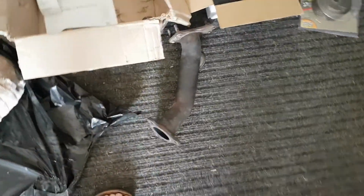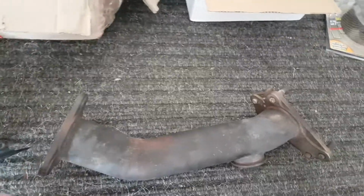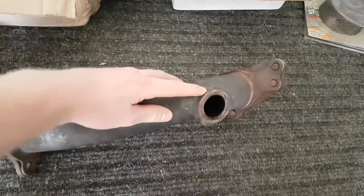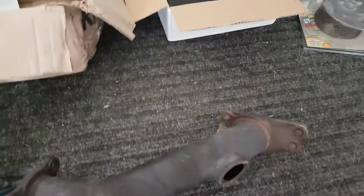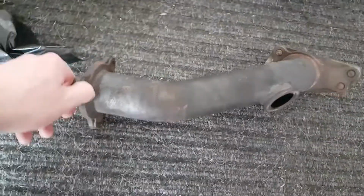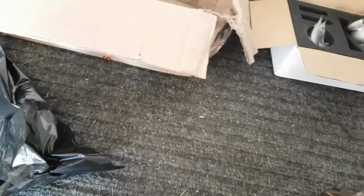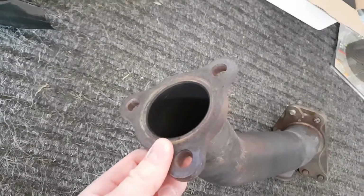and then at the same time, I purchased just a GT spec uppipe. The reason I went with this uppipe is because the Tomei uppipe that comes with these headers doesn't have the external wastegate flange, and I'm running the external wastegate setup with the Tial wastegate over there, the 38mm. Your only real options for the external wastegate uppipe for Tomei headers is either this GT spec or the Grimspeed. They're the only ones that I think have an external wastegate flange that also have this 3-bolt setup. As you can see, the Tomei headers have a 3-bolt flange there.